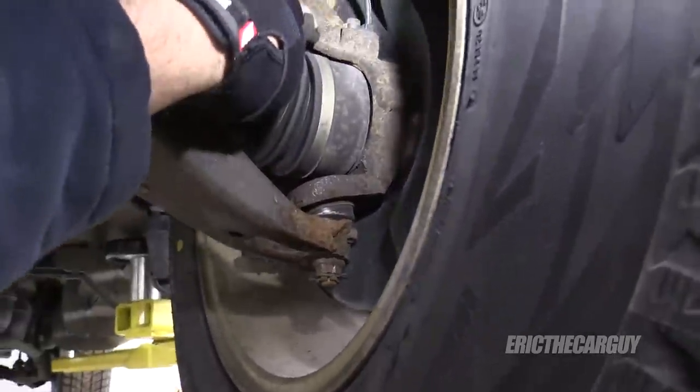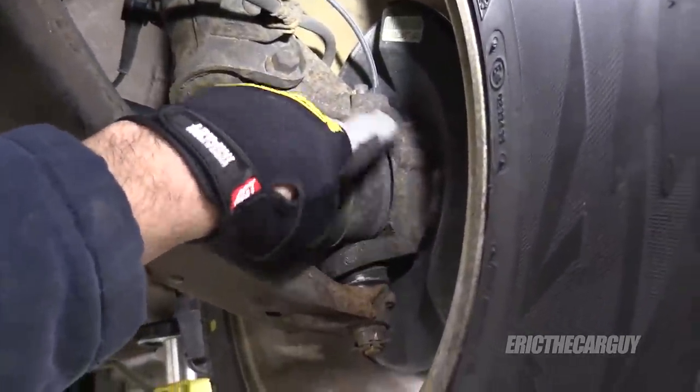If you went and purchased the lower ball joint from Honda, they don't have it available separately — you have to purchase the entire knuckle assembly which contains the bearing and everything else. So if you did go that route you'd have to remove the knuckle assembly, remove your old hub, get off the old bearing race and replace the bearing, press in a new bearing into the new hub, press the hub assembly back in, and put the whole thing back together. I'm not doing that in this video. I'm going to cover the replacement of just the ball joint itself. There are parts available in the aftermarket — I will link them down in the description so you can find them.